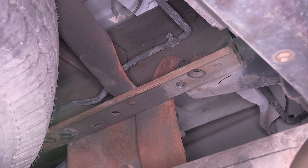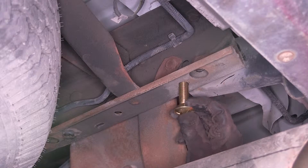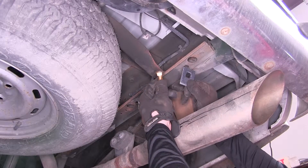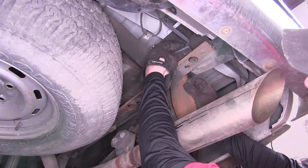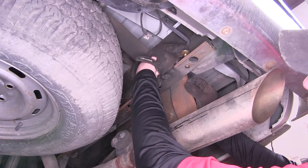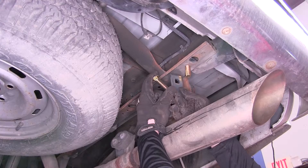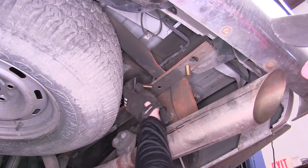Now with our passenger side drilled out, we can take our 9/16 carriage bolt and double check to make sure it'll fit. With our hole drilled out, we're ready to install our hardware. We're going to take our 9/16 carriage bolt and spacer block, engage the two, and put them above the frame channel, dropping them down through our pre-drilled hole. Once we get the hitch in place, we'll use the 9/16 flange nut to secure it. For the center and forward attachment points, we're going to use the half-inch carriage bolt and block, and then once the hitch is in place, we'll use the half-inch flange nut. Let's go ahead and put all our hardware in place.